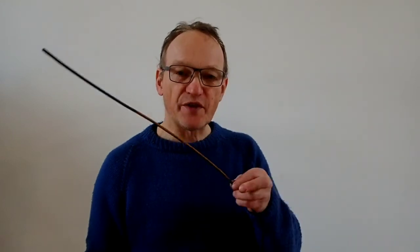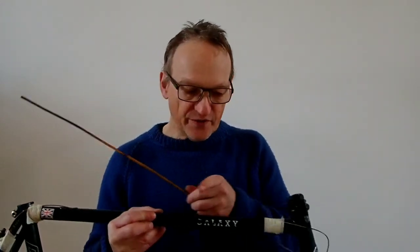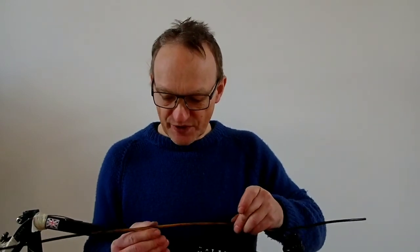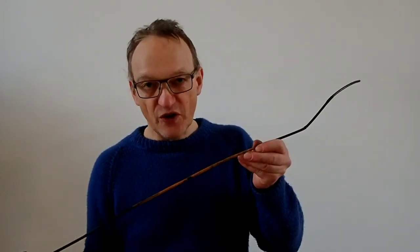So before I do that, I found this product, Fluid Film ASR. This is not a product endorsement, because this is just what I happened to find available online in Germany, and amongst other things it claims to be suitable for treating bicycles and to protect inner chambers against rust and to combat existing rust. I think it needs to do that, because when I pulled the old cable housing out of the top tube, which has drillings for the internal routing of the cable, there's quite a little bit of rust on the cable housing. So I'm going to be treating the entire inside of the frame with this spray.